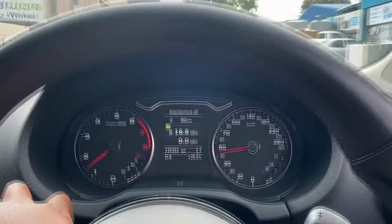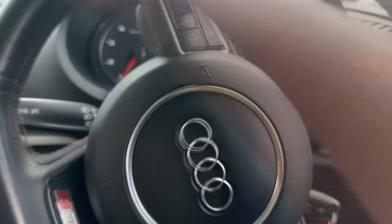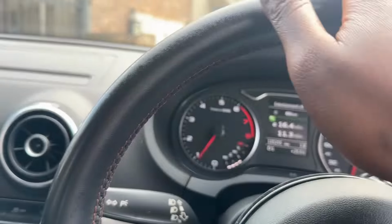Here we go. Okay, so I just need to get in and park. Back at DLB. All right, so that was a successful first drive on his car. So the car is now converted to a DQ250 from a DQ200. We did the wiring, I did the basic settings. The DLB Motorspec guys here helped me remove and reinstall the hardware, and I chipped in with the wiring, and I asked another friend of mine, Dennis from Pex Auto Tech, to come and do the coding. His links are in the description. So it's a successful first drive.